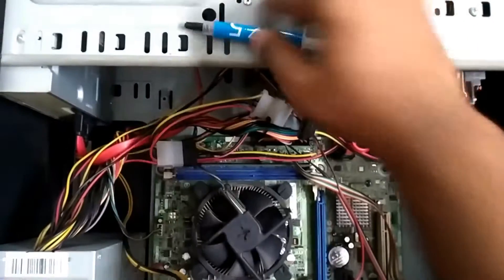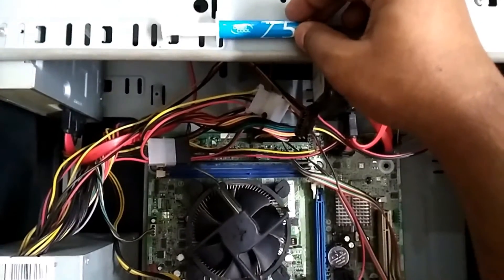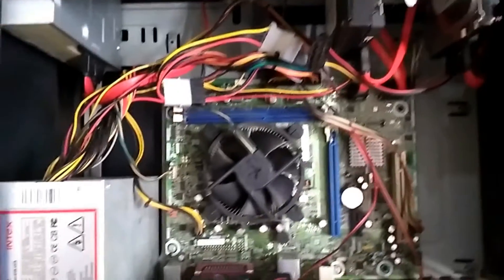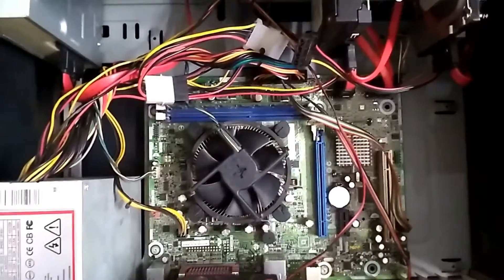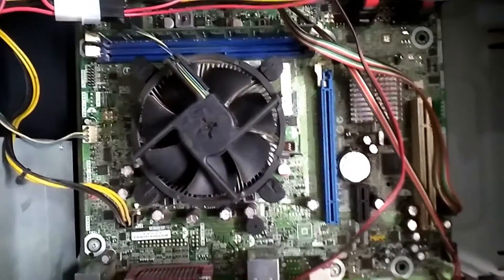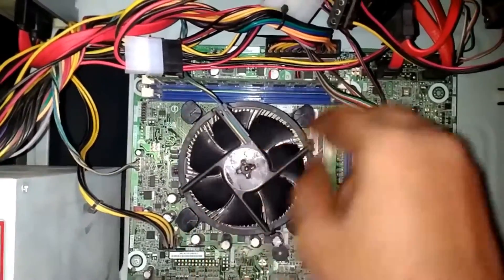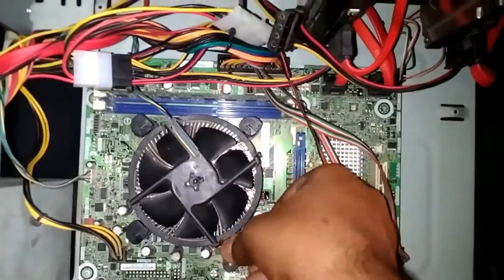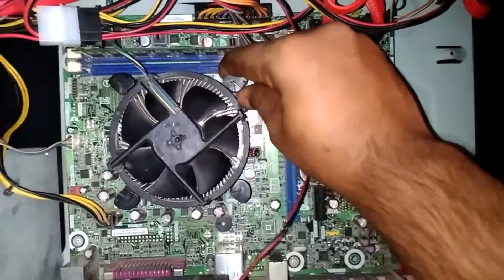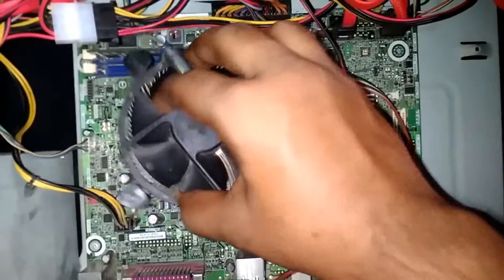Here's my CPU and my rig. Let's put the thermal paste aside — we're going to need that later. First we'll need to remove the CPU fan. This is the CPU fan; you'll need to unscrew the four screws on the sides. Let me turn on the flash. We need to unscrew them and pull them up as we unscrew them.